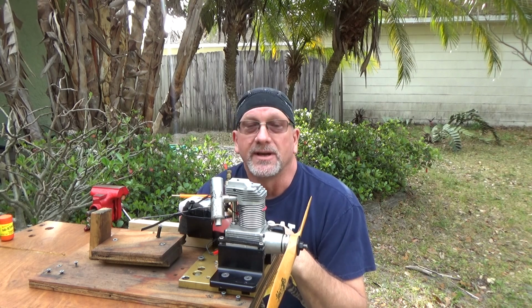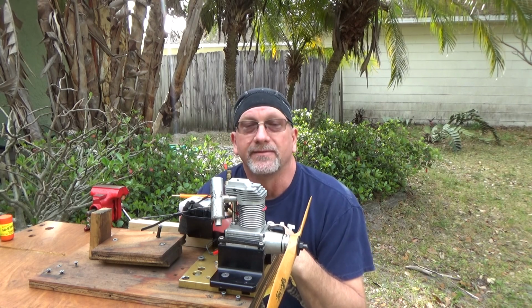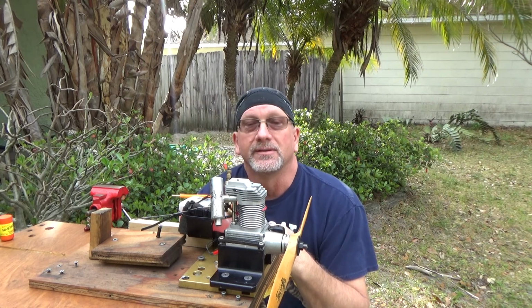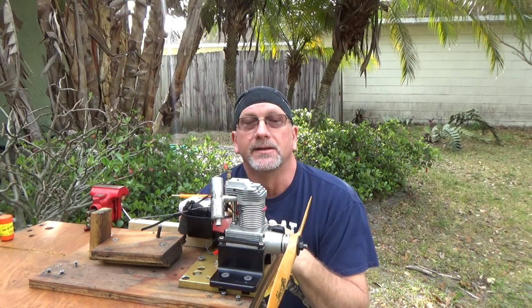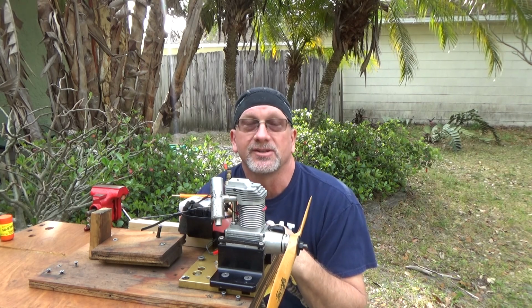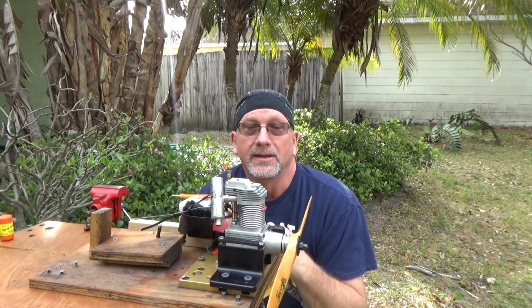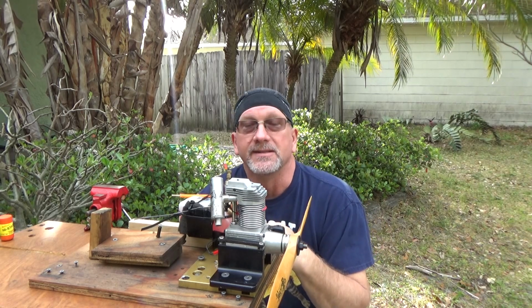What I've done is I tried several different plugs and washers and tried to find a way to mitigate or seal that leak. I've looked at the threads in the opening through as much magnification as I have here, and I don't see any damage, but sure enough I can hear the leak, and if I were to spray alcohol in there I could see the bubbles.